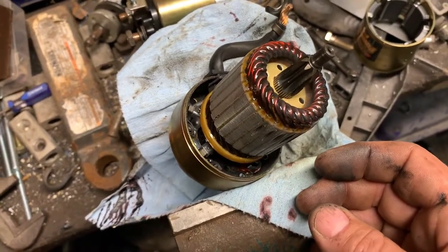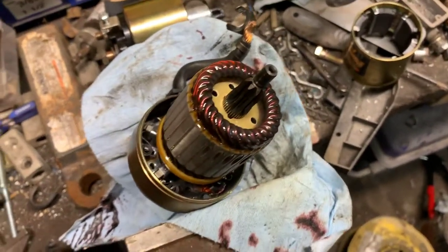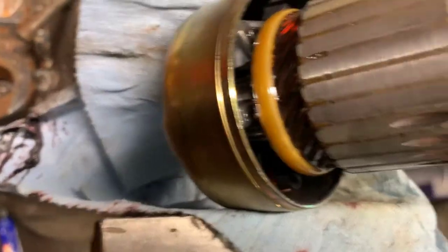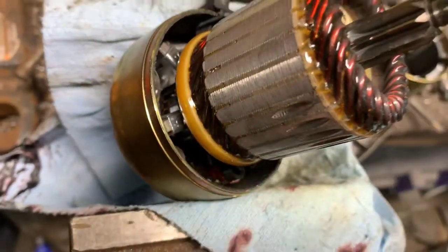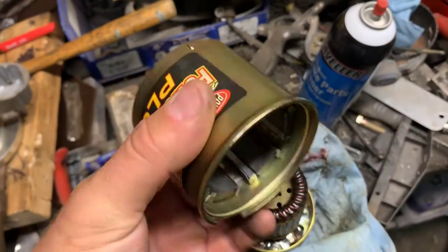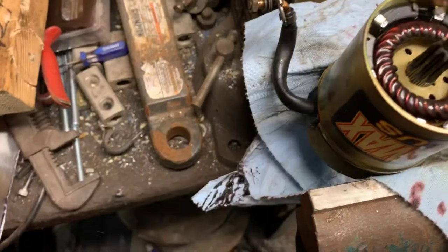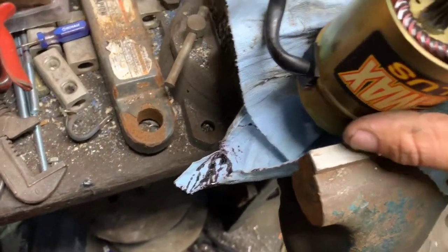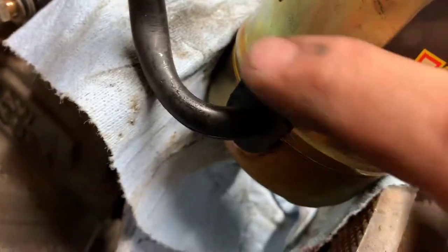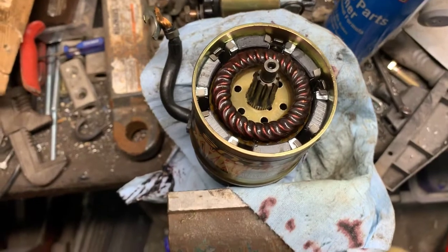This was a brand new starter — it isn't even two months old. So I'm going to go clean all the brushes and crap in there, grease everything up, put it back together, and put a solenoid on it. Now we take this part, cleaned it all up. It goes over and it's magnets — keep your fingers back. It's nice because it can only go one way; there's a notch right here.